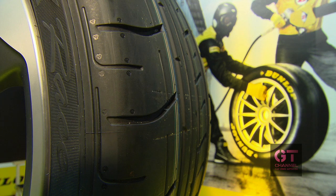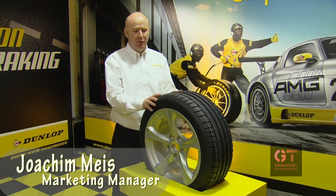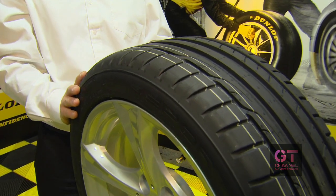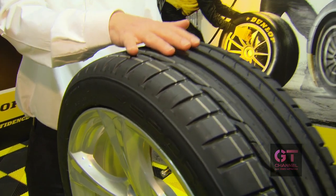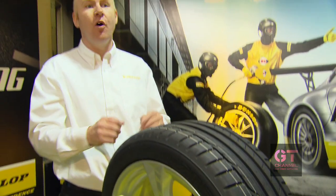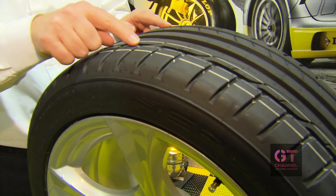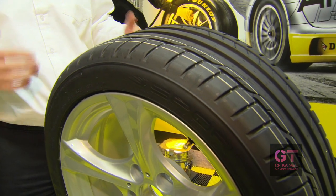What we are looking for is grip and braking mainly. In the pattern we have the massive outer shoulder block, which is really large — this is for grip on dry handling. In the center you have the wide groove for water absorption, and then on both shoulders you have the short braking blocks which help with braking on wet and dry surfaces.